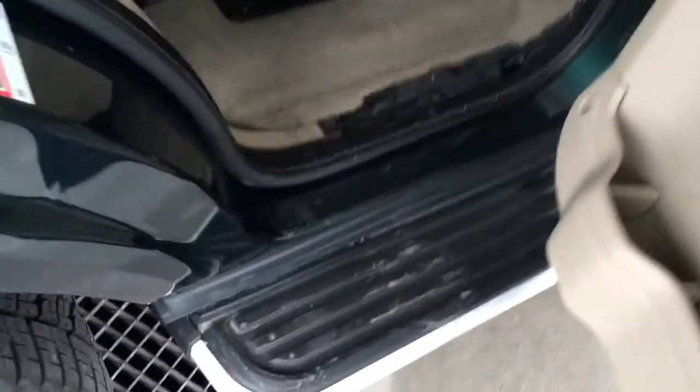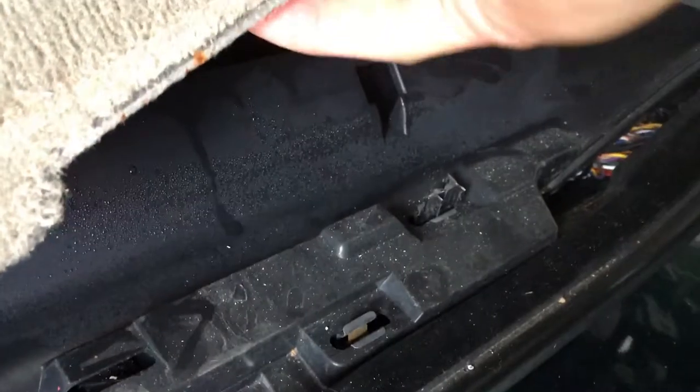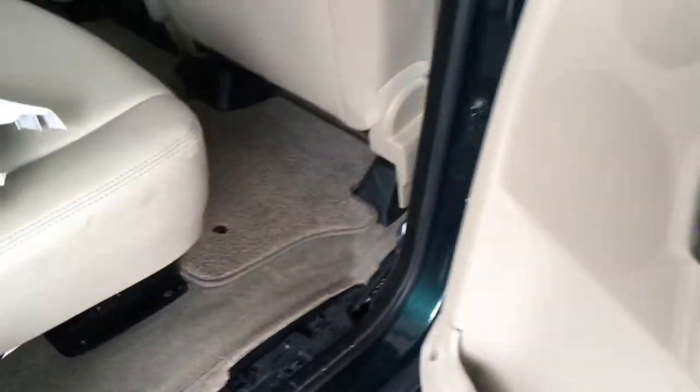It's then followed the car all the way back into the rear. If we pull this carpet up a little bit, we can see condensation under there and it is wet as well. The water is sitting in this trough area — so there we go, a common fault on the Discoveries.